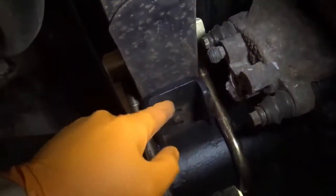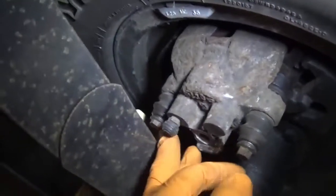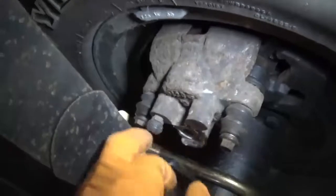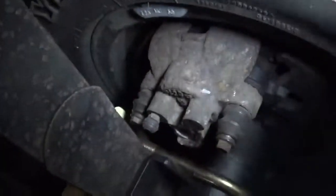It was a pain to get this axle in when the leaf spring was not exactly correct — it was a royal pain. Now one thing to note as I roll down over here: since this passenger perch is three and a quarter inches from the backing plate, this bolt — I sort of had to shave the head a little bit just so I could get the caliper in here and bolt it down. The bolt was just a hair too long, and I'm okay with that, because you can still get this out — you just unbolt it with a wrench, go up against the leaf spring, and slide the caliper out.